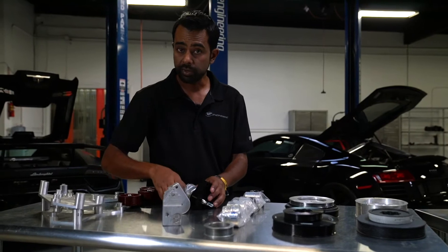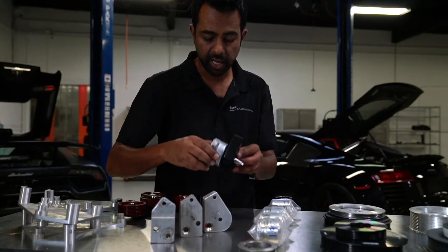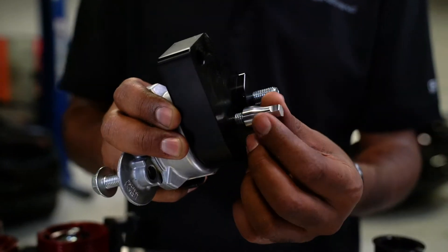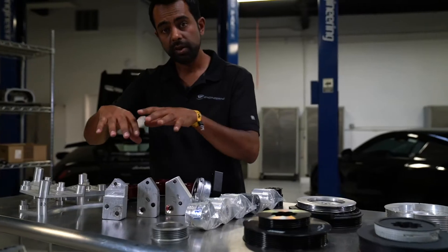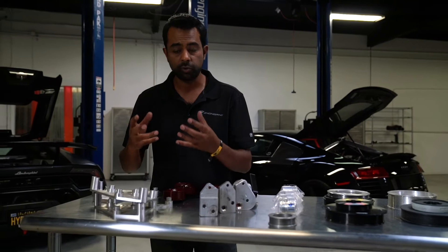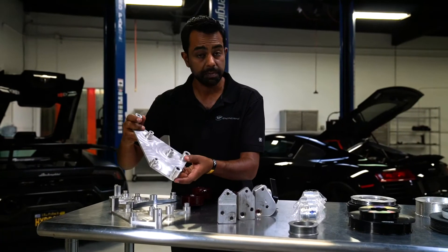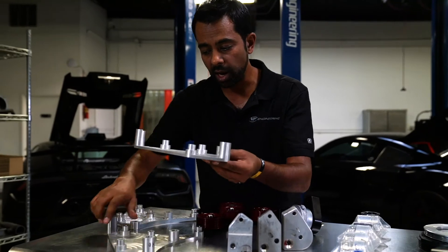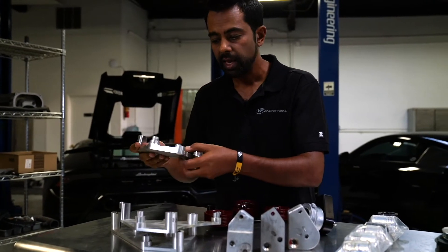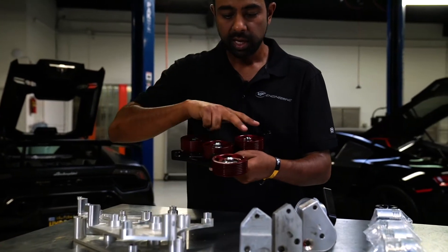The alternator belt also requires its own tensioner. You can see here some crude designs that we created — all of these were made 10 years ago — and then the final version with the tensioner mounted to it. You'll also notice a custom nut that we created, not just for looks but for accessibility. The belt runs through a series of idler pulleys as it makes its way to the supercharger, with the concept of getting optimal wrap around the supercharger for best traction. We created a very rough prototype idler bracket from a thin piece of plate and some spacers, transposed those mounting points to a slightly larger version, then a pre-production piece — thicker, with pockets and webs to lighten and strengthen it — and then the finished manufactured version coated in type 3 anodizing.